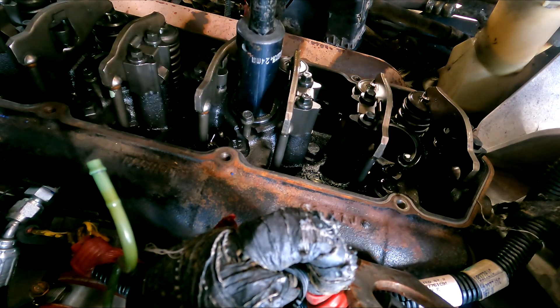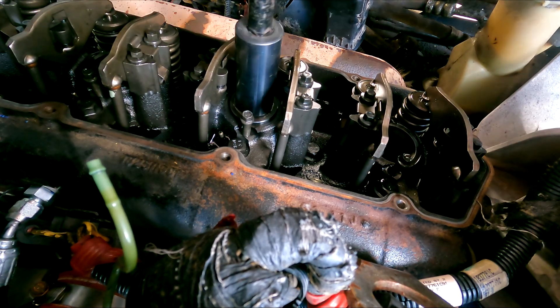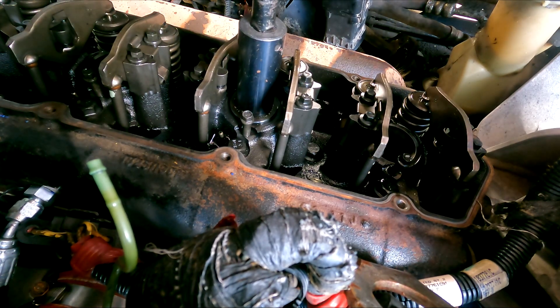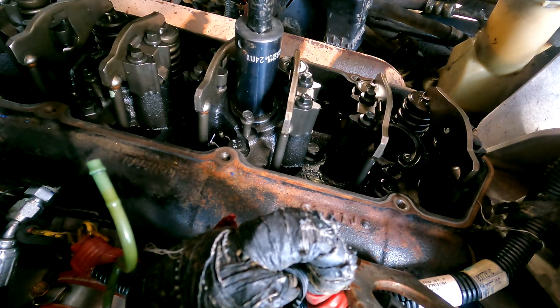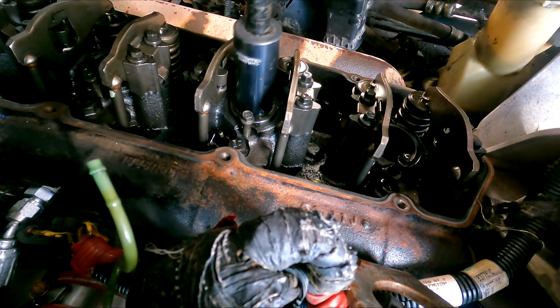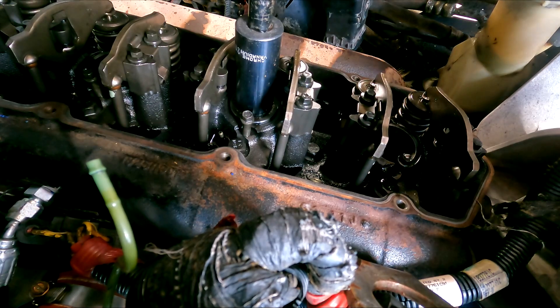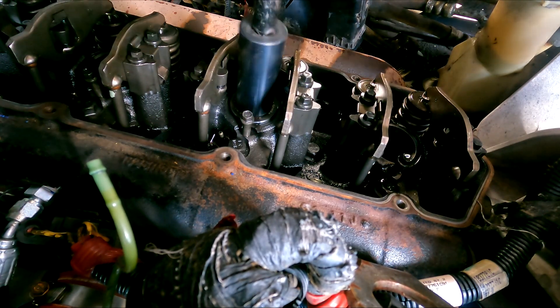These two cylinders I did in real time — I didn't speed it up at all. The pains and struggles of turning a socket slowly — access is fun. For the back cylinders you've got to lay down sometimes, but aside from that it's not a big deal. It worked out pretty good. You just do a few turns on this puller — and since the cup is brass, it can't be in there with that much force. You can tell when it loosens up that it's coming out, and there it is.